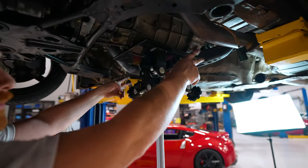On top of that, we're going to replace this fork. Dave's car is an '03, and in 2003, clutch forks were stamped. The pressure plate changed in '04, more clamp load, so they made a new fork to handle that. Well, we're going beyond even that '04 upgraded one with the Z1. So we're going to change the fork, change the throwout. This boot has a nice little tear in it. We're going to get that out, re-grease all that. So let's get it all broken down first.